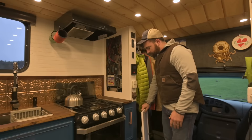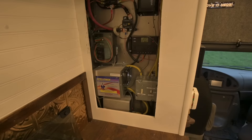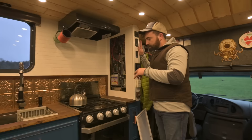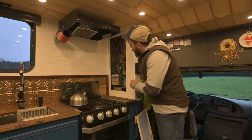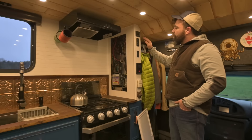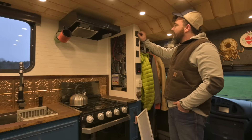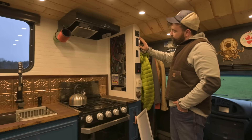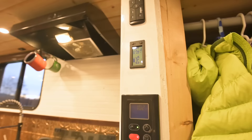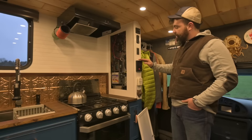This is our electrical cabinet. When we cut out the walkthrough to give ourselves open closet space, we rerouted all the electrical from the original box in here. We have our shore power charge controller, our solar charge controller, and the controllers for the electric locks. Down here we have an inverter that handles all our 120-volt power. There's a big breaker and a bus panel with fuses for all our circuits throughout. We also have a Bluetooth amp — we can switch between inside music, outside music, or both. This is the charge state controller with a hall sensor that tells us how much power we're using, how much we have remaining, and our battery voltage.